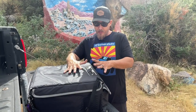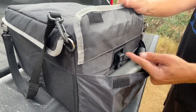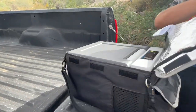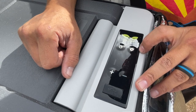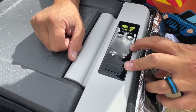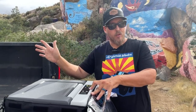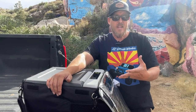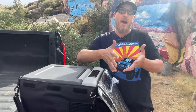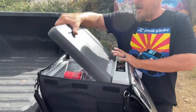Let's take a little more in-depth look. On this side you have your battery carrying spot with your plug-in hole. Your controls right here — you can go up and down with the temperature. You can also turn it on economy or max. Over here is your battery setting: high, medium, and low. High is going to give you the most protection so you don't kill your vehicle battery. If we were plugged into my truck and worried about killing it, I'd put it on high.